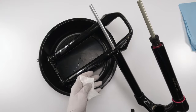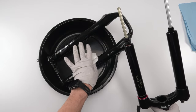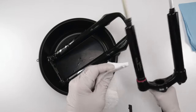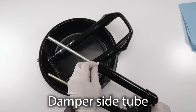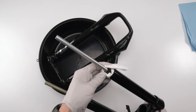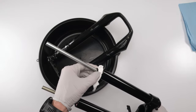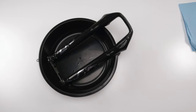We're not going to work on the upper tubes yet. We'll first continue on the 50-hour service, which is working on the lowers. Temporarily, since oil gets inside and leaks out when you let it sit on flat ground, take a little paper towel, put it around the rebound inner tube, and let it absorb anything that comes out. Just tuck it in there and put it on the side.